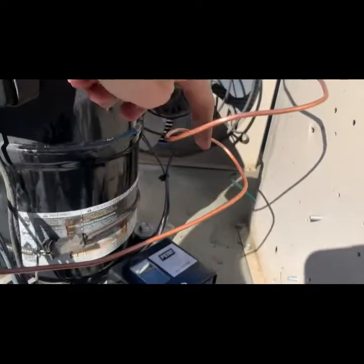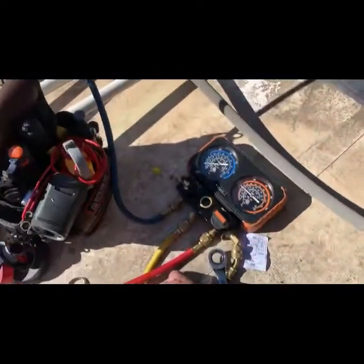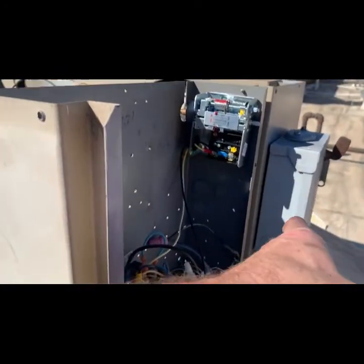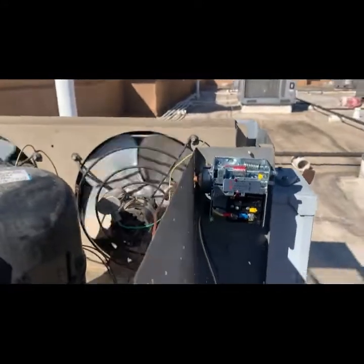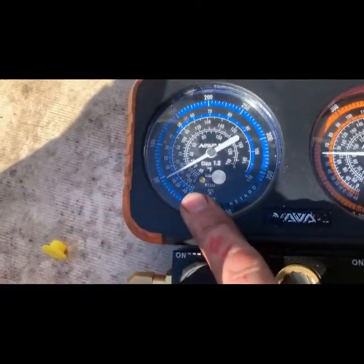I've routed the cap tube — I don't like coiling it on itself because over time I feel like they rub out and you get little holes in the cap tubes. So it's not nice and smooth and pretty, but it's there. It's not going to come on because I have the thermostat turned off. Point of clarity: when I powered this down it killed the power downstairs — when I turned it back on it turned the thermostat back on, and now we're running.